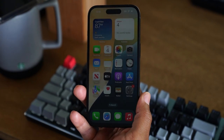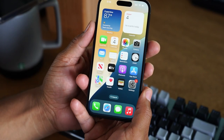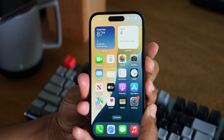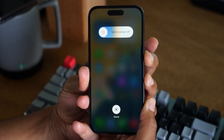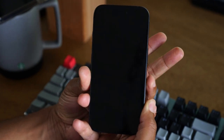If your iPhone 16 is frozen or your touchscreen is not responding, do this. You're going to tap the volume up, volume down, and hold the power button. Hold it until the screen goes blank — usually it takes no less than 10 seconds for the screen to go blank, and that will basically force the restart.